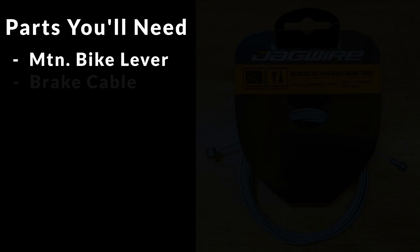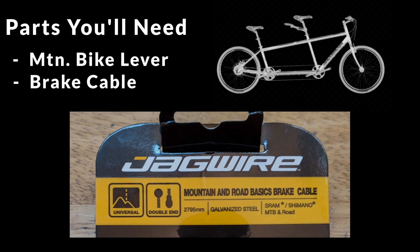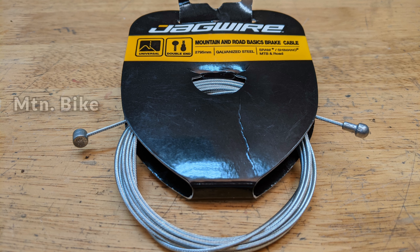Next, you'll need a universal bike brake cable. To give yourself the most options for routing, I'd recommend you get a universal brake cable for a tandem bike. Tandem bikes are really long to accommodate two people so the rear brake cable needs to be extra long also. The last one I bought was 2,795 millimeters, which is about nine feet. I've seen them as long as 3,500 millimeters, which is about eleven and a half feet. It's important that the cable has the correct end on it to fit your brake lever. Mountain bike style brake levers use the fat cylinder-shaped ends; road bike levers use the mushroom-shaped ends. A universal cable will have one type of each at opposite ends of the cable, so don't cut the wrong end off or you'll be buying another cable.